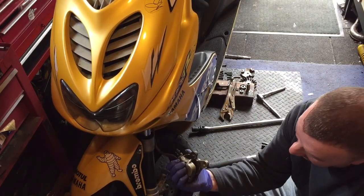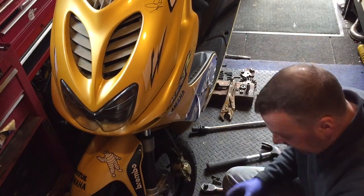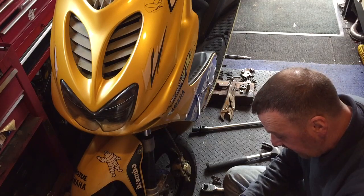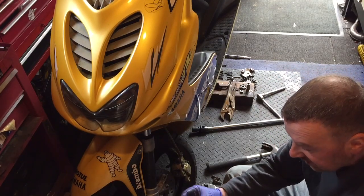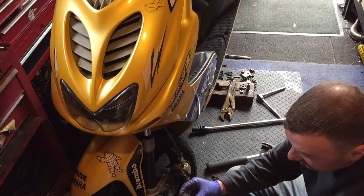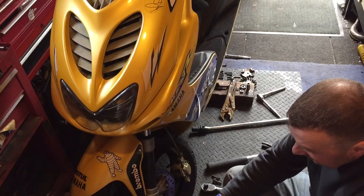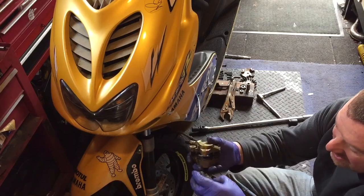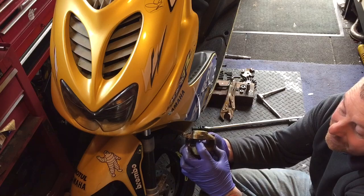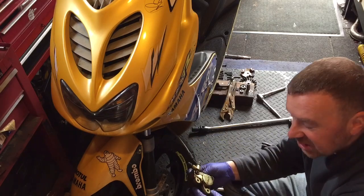This one's straight back lovely — both flush and I put copper grease everywhere. It is that simple. I mean, I can do it in front of camera and put it all back together, but it's a longer video than it needs to be. Clean up the excess on the disc and the pad — just scrape it off. That is road salt, just crap on the road. Just clean it off — you don't need it on there. Back to grease again. Look, you can see that now — this was honestly binding before. Look how nice that is. Now that's moving up and down lovely. When you put the brake on, it goes back and forth lovely — there's nothing stopping it and it will return.